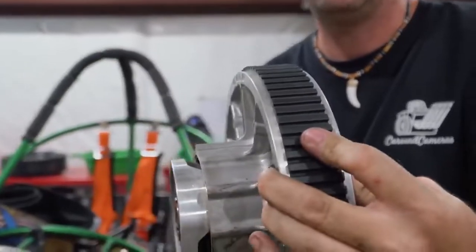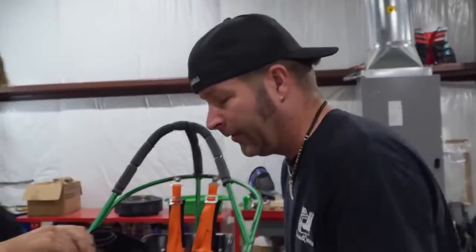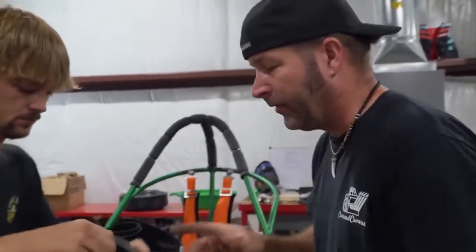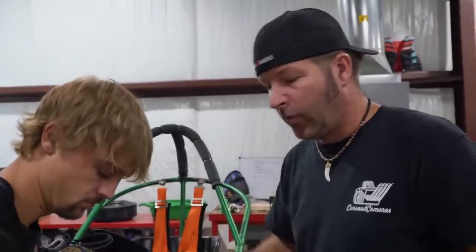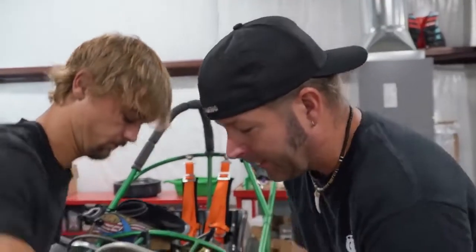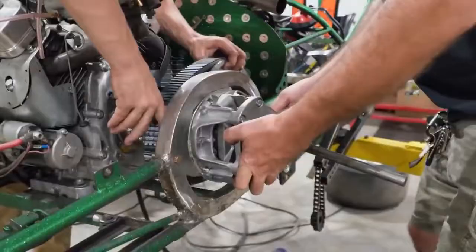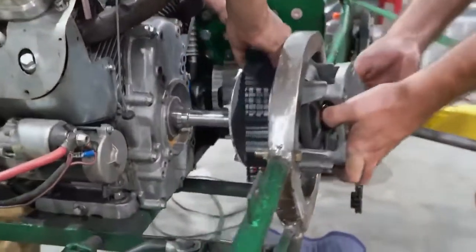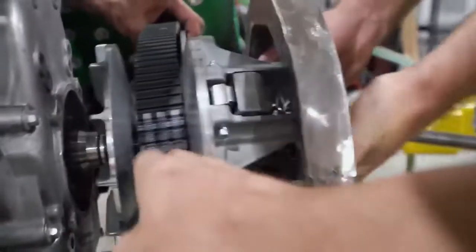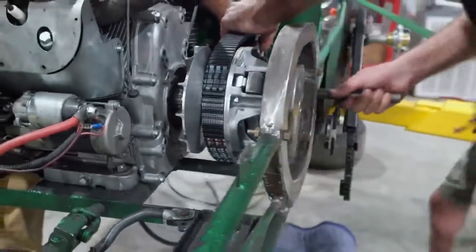The other belt actually sunk down into the groove way too far. And that's losing gearing right there. Plus with the larger belt, we'll have more surface area for biting. Exactly, thank you, Charles. As you can see, the belt fits really nicely down into the base of that groove, so the width is dead on.